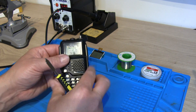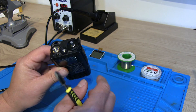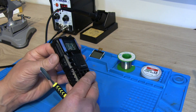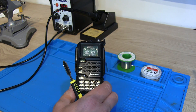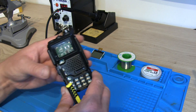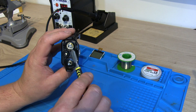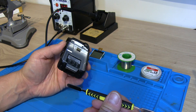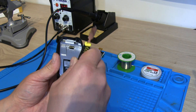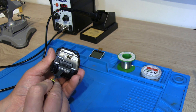I've put the parts to one side — I've already removed the volume knob and the antenna. You can see there are no buttons in this; I didn't bother putting them back in after last time, but they're safe and ready to go back in afterwards. All we need to do — we don't need to undo that nut at the top — it's just a simple case of using the small prying tool and gently prying from the bottom and popping the radio out of the casing.